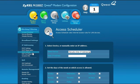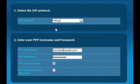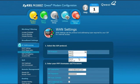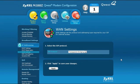Before continuing, if you're using PPPoE from Qwest, you should write down your PPPoE username and PPPoE password if you don't already have this info readily available. You'll need to configure it on your existing router. In the ISP Protocol drop-down menu, select Transparent Bridging. When finished, click Apply.